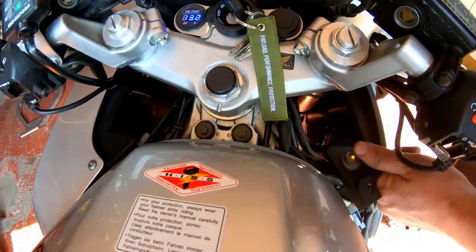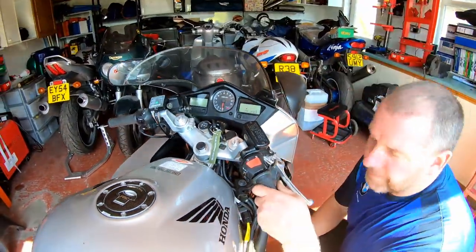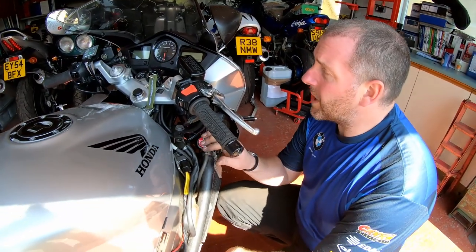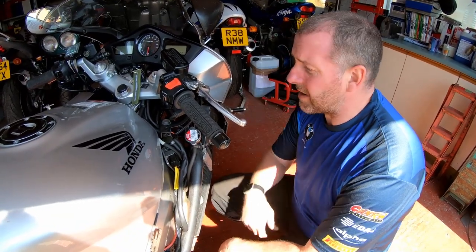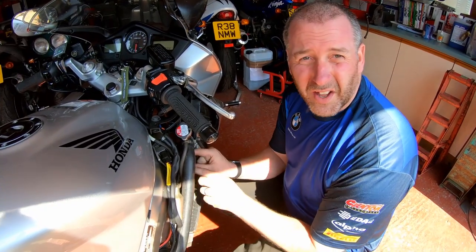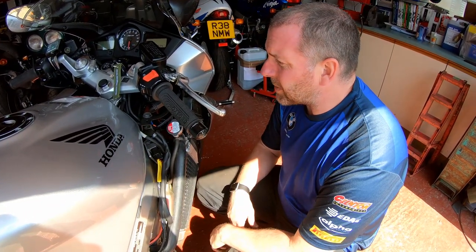The little orange indicator is quite bright, so you shouldn't ever walk away from the bike with it left on. If you wish, you can always wire it into a switched live like the headlight — you can wire it into there if you wish. But I didn't want to. I wanted to use the connector that I'd left behind from the previous reg-rec. I'm perfectly happy with that.